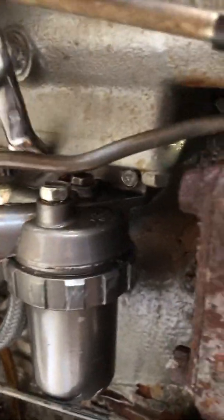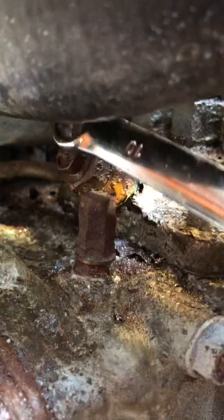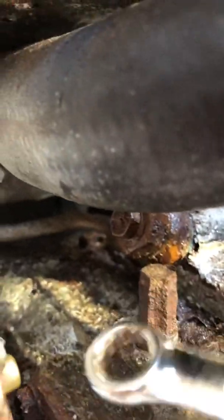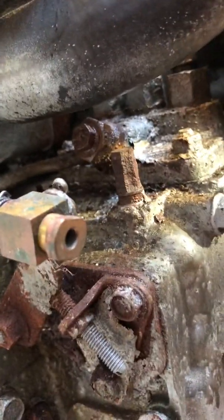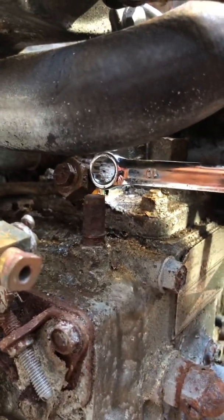So after that, it goes from lift pump, fuel filter, fuel line. You follow that up to this nut — it's all rusty — this is the bleed nut for the high pressure pump. I didn't take this off; you don't mess with that. It's this little guy in the front. You crack that just a wee bit. Then I can still pump the primary filter pump because this is all still low pressure. I pump it until it starts squirting fuel out — all bubbles gone — then pumped it a bunch more to make sure, with diesel-soaked rags down here to catch the drips. I pumped it until it was just straight up squirting nothing but diesel out, then cracked it off and closed it.